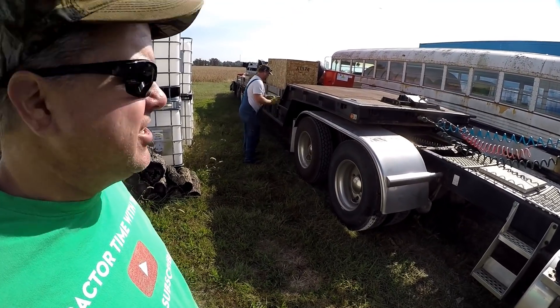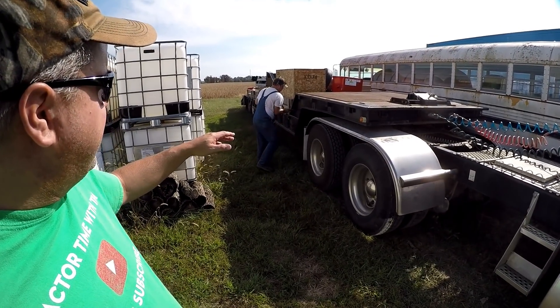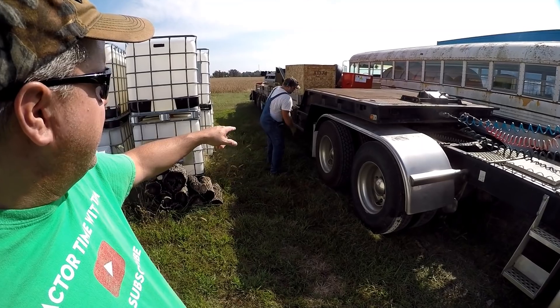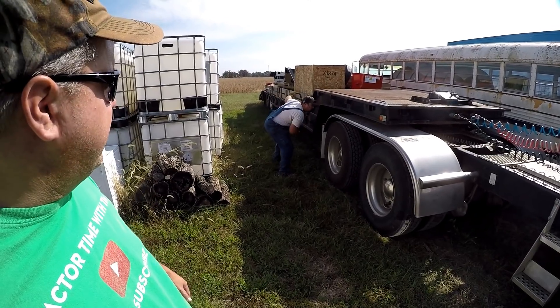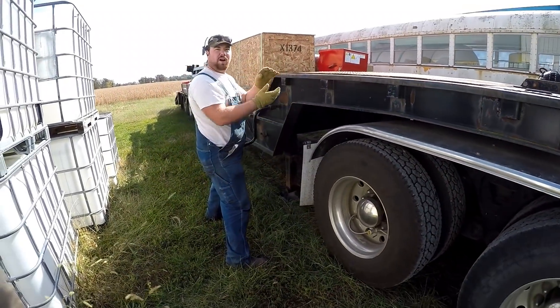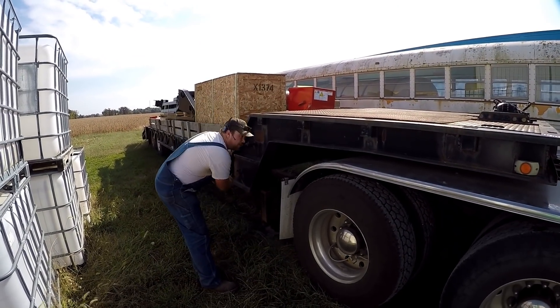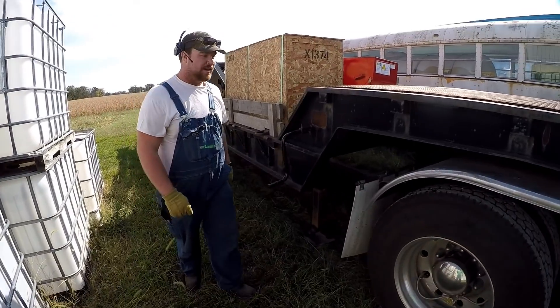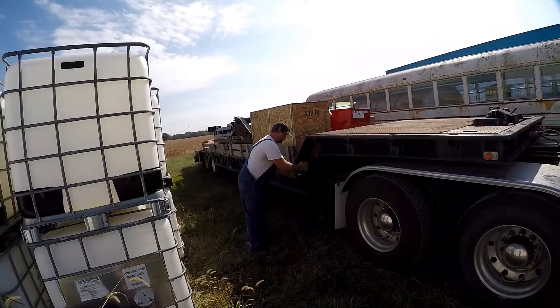That jack is made almost identically to our trailer jack — actually it looks like it cranks faster. It's a two-speed jack. Notice he's cranking really hard and then pushes in — that shifts gears, then it cranks easy but doesn't crank up as fast. Our jack on our trailer only has a single speed. Can you hear the air underneath? The leveling valves are letting air out of the bags since we took weight off, to keep it at the right height. Those kind of things are obvious to guys in the industry but if you don't do it, you just don't know those little tricks.